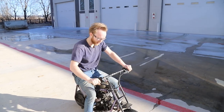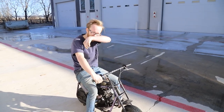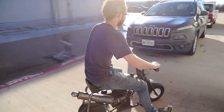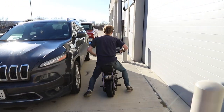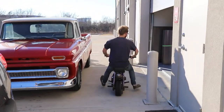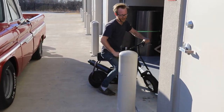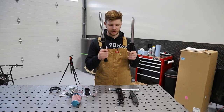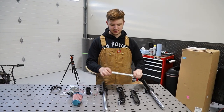It ripped! Want to take it for a ride? Yeah, I'll take it for a spin. We just had to say it's bad to start and then it'll start right away. Once it starts you just gotta go or it's gonna turn off. As we mentioned, we're doing a front suspension upgrade - the only modifications we'll probably have to do are the spacers for the front axle bolt and the holes for the bolt that connects it to the fork neck.